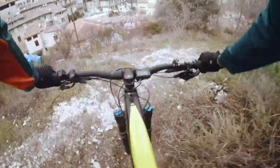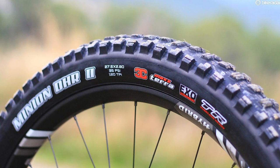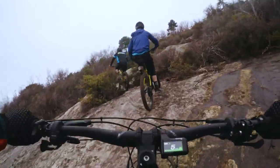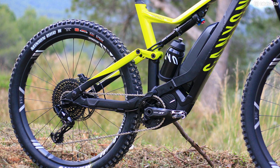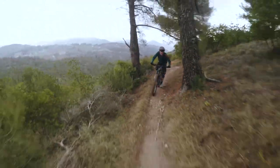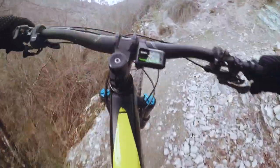So how does the Spectral On 8.0 actually ride? I came away very impressed with certain aspects of the bike, though there are some I think could be improved. The concept of a 29 inch front wheel and a 650b plus rear wheel, if the bike is designed specifically for that on an e-bike, is a great idea. The amount of traction from the Maxxis Minion 2.8 inch tyre at the back was incredible — we rode up amazingly steep stuff in the south of France on wet loose rocky terrain and you could feel the rear tyre deforming underneath you, creating all that mechanical grip. It was a really impressive feeling going uphill. However, the 430mm stays are there to keep the bike relatively agile. If you're looking purely at climbing performance, they could have gone a touch longer for a little more traction and more centred weight. With a 29 inch front wheel and 160mm forks the front end is still relatively high, so you do have to drop your elbows to keep the front wheel planted. There's so much grip on offer I feel the geometry could aid it even further. That said, it is without doubt one of the most impressive climbing mountain bikes I've ever been on.